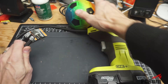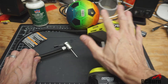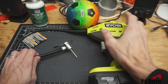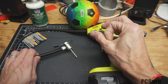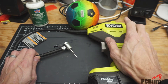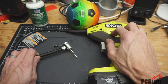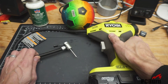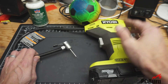So as you can see, that actually worked out okay. Now I'm not sure how long the ultra disc brake caliper lube is going to work in there as a grease, but it seems to be working fine now. I probably improved it a little bit over new, although it might cause additional wear — whatever. I'll have to take it apart after a while of running it and see if it's still working okay. I think that seal on the inside — the one acting as the ring and the release valve for the air — is probably your biggest wear component on this thing, and I don't know that it's really that replaceable. I could probably model something, print it in TPU, and replace it, but I'm not sure how long that would last. And that's it — inside the Ryobi, got it fixed, works better now. Rather, it works. Period. And it's much improved from where it was when I started this. Hope you learned something from it. Thanks for watching, and I'll see you next time.